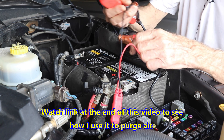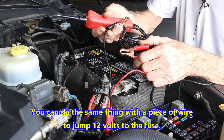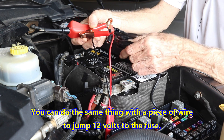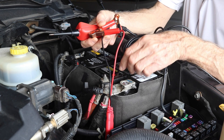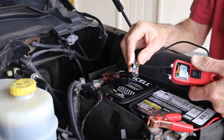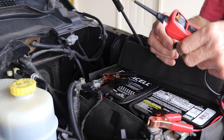You can use it as an ohm meter. You can also use it to check continuity, and you can also apply voltage to certain things with it. It comes with a very long cord, as you can see here, which is good for troubleshooting like your trailers, brake trailers, or rather boat trailers, or just any kind of trailer where you want to check your lights and that sort of thing.